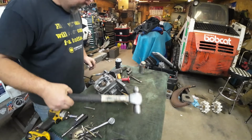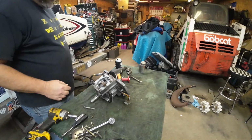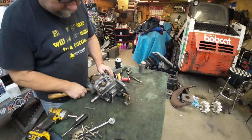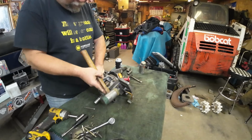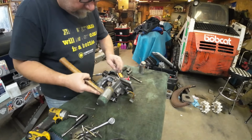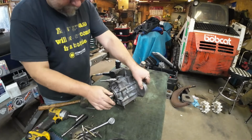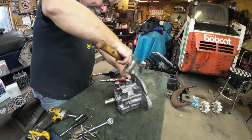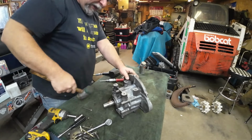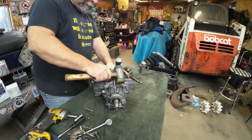All right. We are not going to hit anything with this hammer. Let me grab the soft hammer. We'll give it some persuasion. All right. I could see there's case sealer on this, so I know it's going to need a little love. Don't get too crazy, especially in these lighter parts out here. It is dowel pinned, if I remember correctly, so don't try to spin it either.